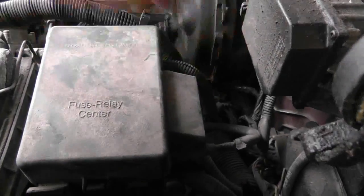So what you have to do is connect the orange up to the terminal block here, and route the blue wire into the cab. Actually, you can't see it, but under here there are two terminals for auxiliary power. You've got to route there, and bring one of those inside to power the brake controller, which powers the electric brakes at the back as well. So anyways, that mystery is solved.